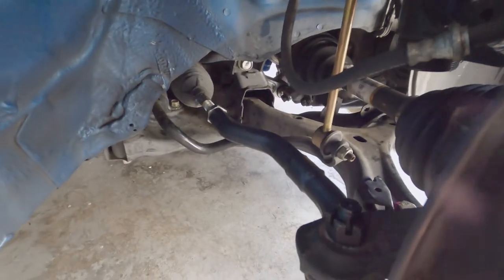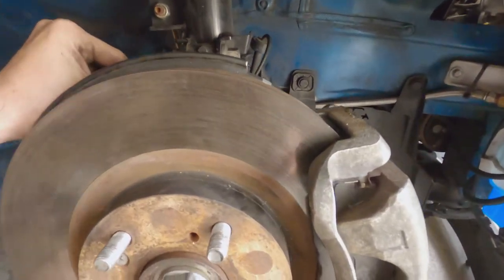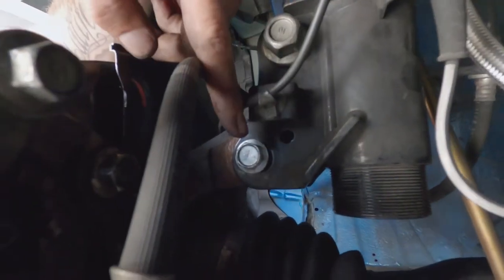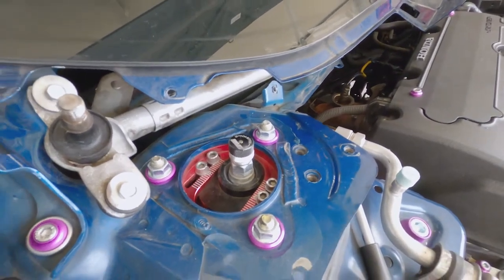I'm not going to snug down the tie rod at all since it'll need to be adjusted anyway — for now everything is hand-tightened. Switching to the second hole definitely made it easier for the tie rod to go on. I thought I had more camber than I naturally do from slotting the strut, maxing the camber plate, using a smaller bolt in the bottom slot, and shaving the back of the spindle — but it still wasn't enough.